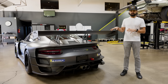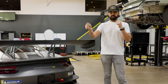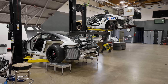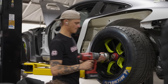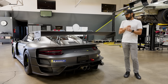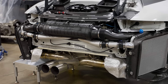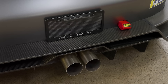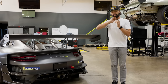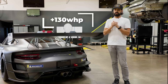What we learned about these cars racing at Pikes Peak — it's funky up there because of thin air and a lot of hairpin corners, so you don't have a smooth track where transition is good. We learned we needed better boost response, more horsepower, to carry a little more top end, extend the shift points out just a little bit, and rev the car out more. This package was developed in 2019. By changing the turbochargers — the relationship between the compressor and turbine side — along with our big 3D printed aluminum intake manifold and improved air inlets with a really free-flowing exhaust, we were able to get rid of a lot of turbo lag. That sharpens throttle response more and more. Not only that, but we also found another 130 horsepower to the tires.